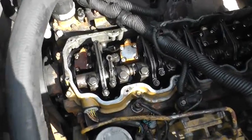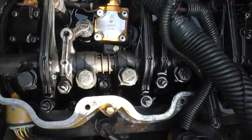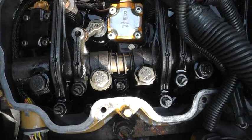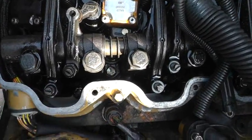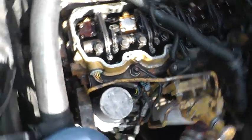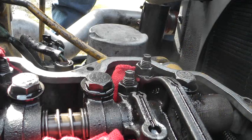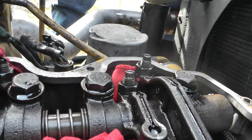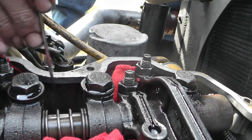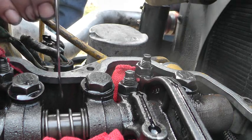I'm looking for these oil drain plugs. I think it's that bolt right there, right down there. Should be one on each end of the cylinder head. Dropping something down into that oil galley would really suck, so I stuffed the openings around this bolt with some rags just to give myself a better chance of success.